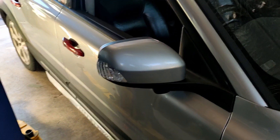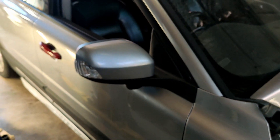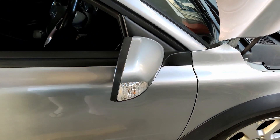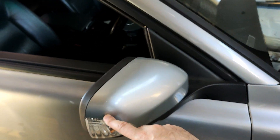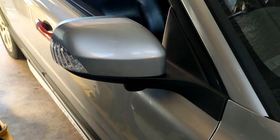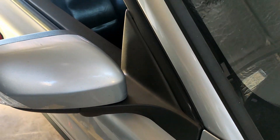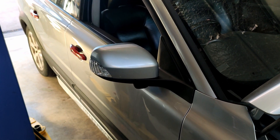I had to dick around with these mirrors. Both the V70 and the XC70 had blind spot sensors installed, but the cameras seem to be calibrated to the computer, and even though I just effectively left these mirrors, it wasn't happy about the change. So I actually had to dissect the V70 mirrors — which are a different shape, more of a sporty looking mirror, a much smaller mirror. I had to remove the camera panels from the bottom and reinstall them. During that I've screwed up something with the mounting on this mirror and it sits slightly proud on this side, so I'll still need to pull that off and tidy up whatever I've got wrong.